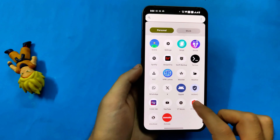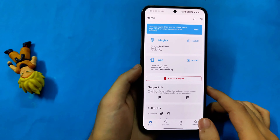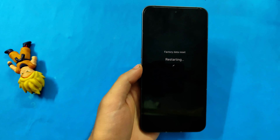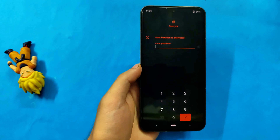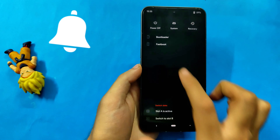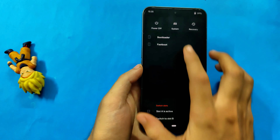Now we'll check if Magisk is retained. Opening the Magisk application — you can see it is still showing 26.3 is installed, which means we have successfully retained Magisk. The last thing to check is whether Orange Fox recovery is retained. We can simply reboot to recovery via Magisk, just as shown previously. We got the Orange Fox recovery splash logo and it is asking for the password to decrypt the data. After entering the password the decryption started and yes, we can access storage. We have successfully flashed the OTA update while retaining root, Magisk, Magisk modules, data, and Orange Fox recovery.